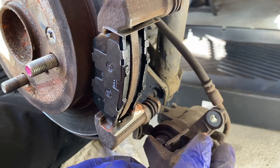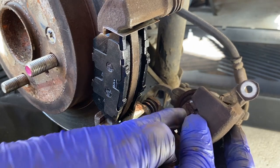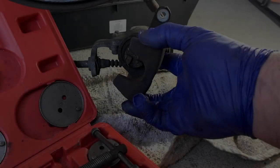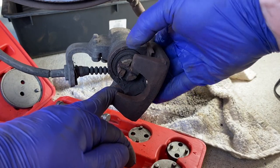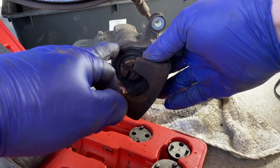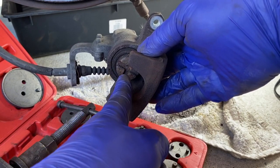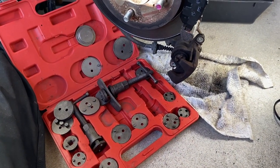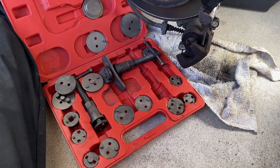This has got a self-adjusting handbrake, so the caliper on this car incorporates both the handbrake and the footbrake. We have to wind the piston in — we can't do it like a front one where you just grip the piston with pliers. We need a special tool for this. On a standard conventional front caliper you'd just push the piston in, but this has got a ratcheting mechanism for the handbrake because the handbrake cable is attached to it — so the piston needs to be rotated and pushed in at the same time. We do that with this tool here; it's only cheap on Amazon, I think this was under £15. It's worth having.